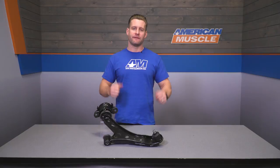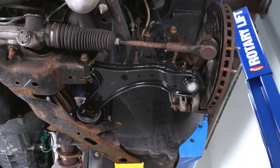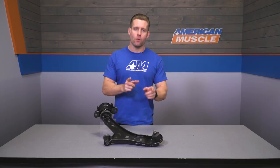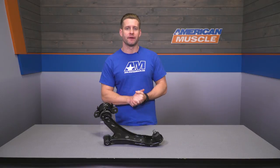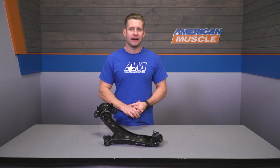All of which can be found right here at AM if you are interested. Keep in mind that these will only fit the 2005 to 2010 model year Mustangs that were built before August 3rd of 2009. The reason being is because Ford switched the size of the ball joint from 18 to 19 millimeters after August of 2009. Read the sticker in your door jamb to determine if these will be the correct arms or if you need the 2011 to 2014 style instead.